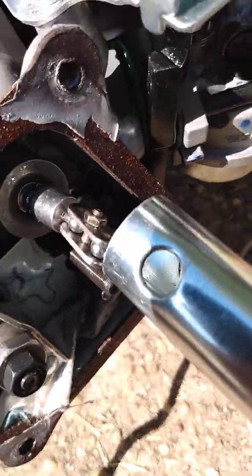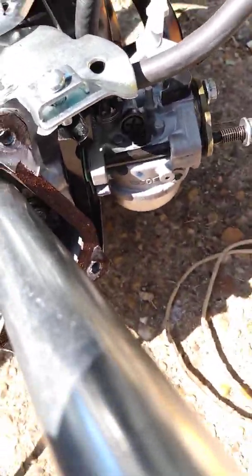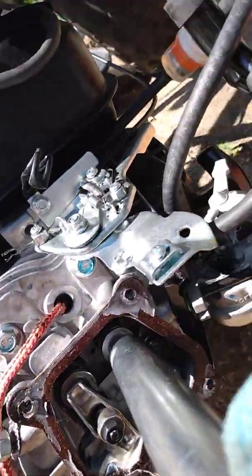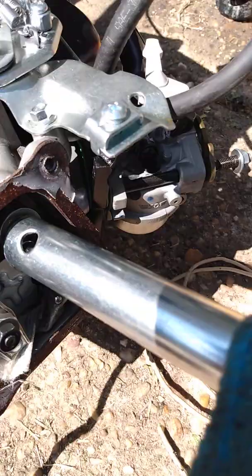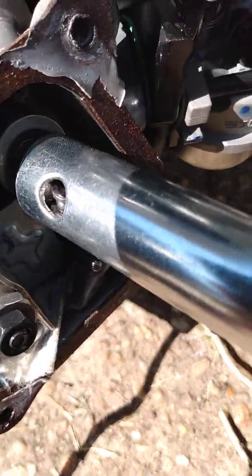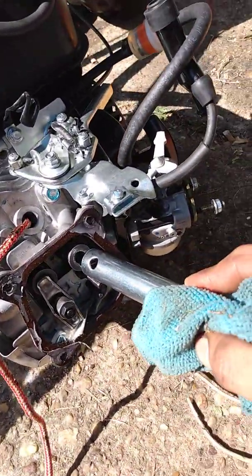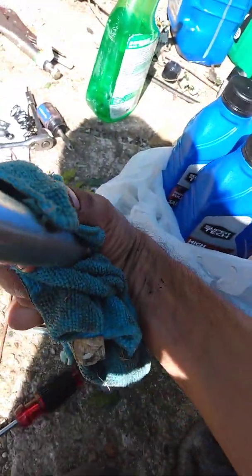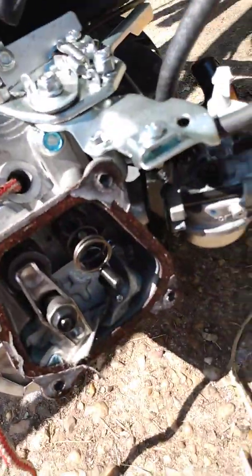Put this on there — you see it? Put your tool over it. Make sure the end of your magnet is at the end there. Put your rag like so. You can see the magnet in there. All you have to do is push — your magnet will catch your keepers and everything with it. Both keepers and the retainer.